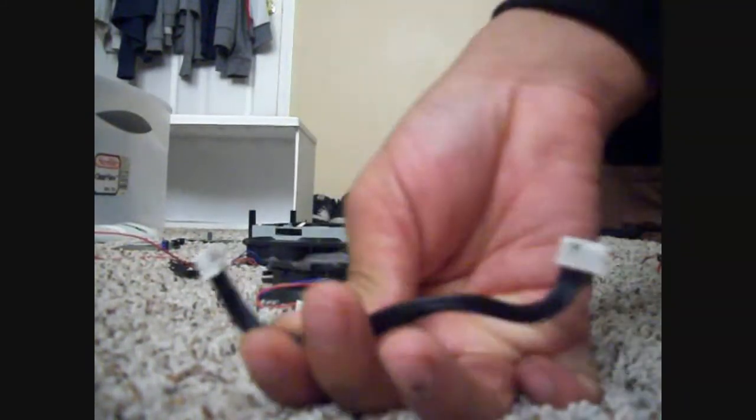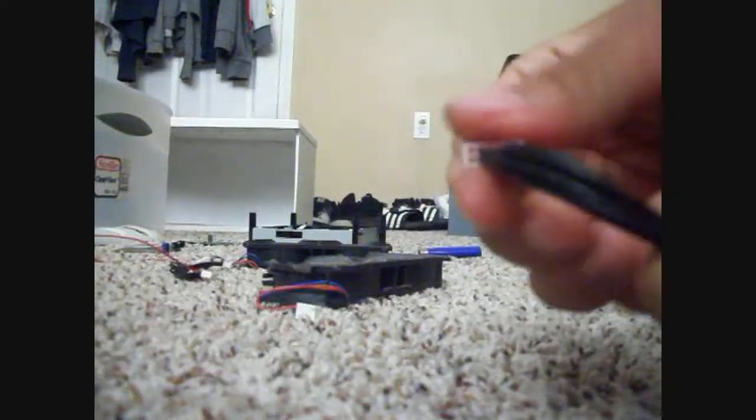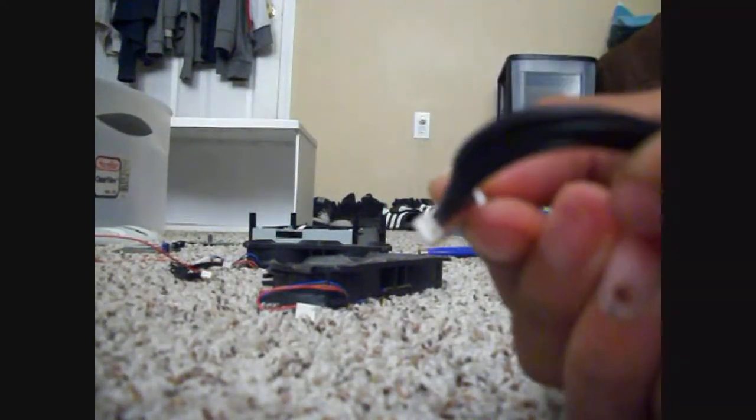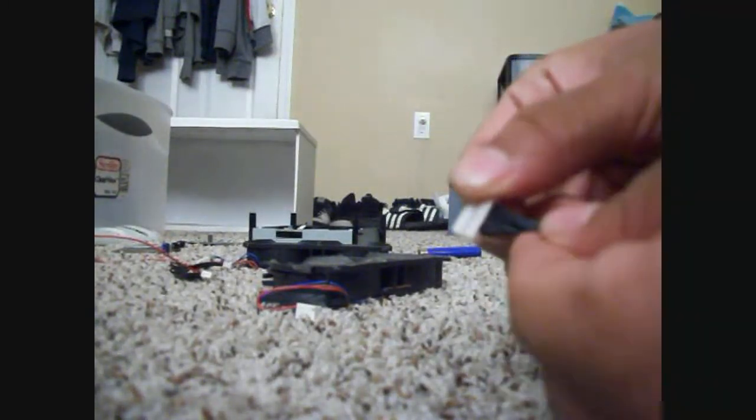What you need to do is take your fan out of your Xbox and take your DVD power cable. First, what you're going to do is take your DVD cable and you see these two empty holes — the two empty ones — all the way at the bottom and all the way to the right is a 12 volt cable.